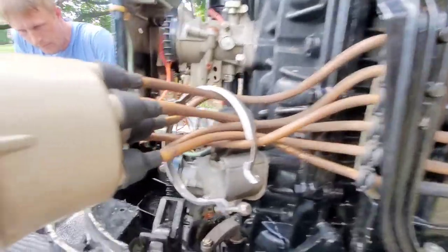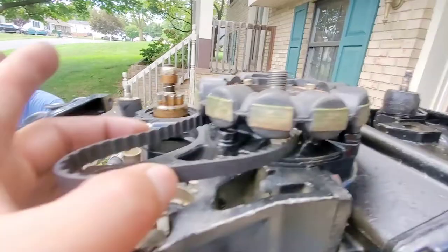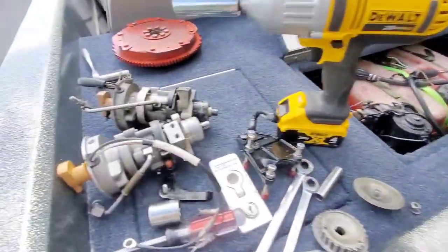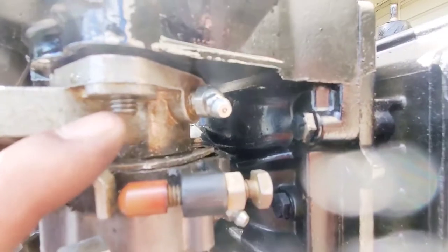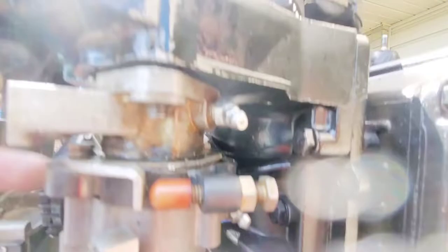I've got everything disconnected. We're going to put everything back together. I've got to try to get this little pulley here lined up with the flywheel, but it's okay. We're going to pop in the new CDI trigger right here — brand new, so we know it's going to spark. We got the new distributor up there. This does not have the threaded distributor, so we're going to have to put size 11 metric bolts here and on the back to get this to go up properly.